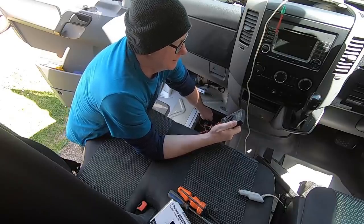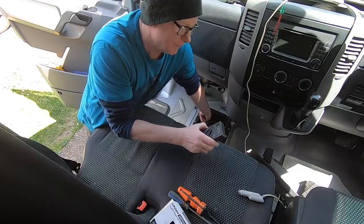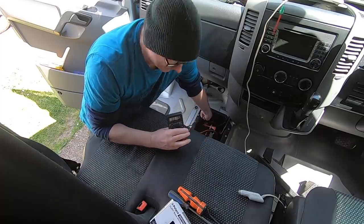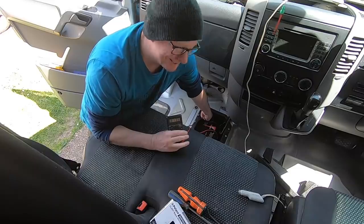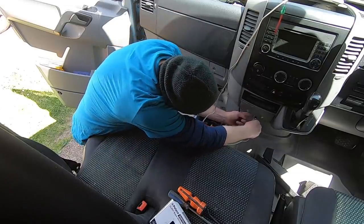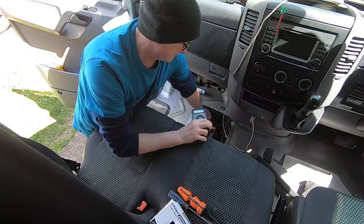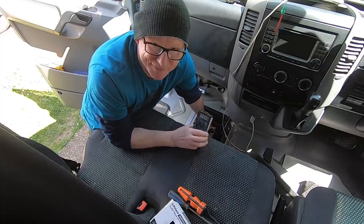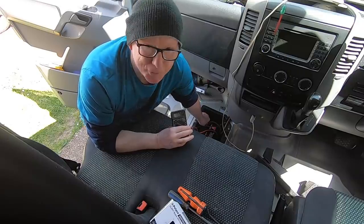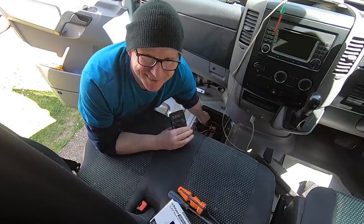My battery's reading - I've got all my interior lights off, though the door is open. There we go, my battery's reading 11.745, fluctuating. I'll push that in a bit better - 11.75 volts. That's just standing still without the solar panel plugged in. Now I'll plug the solar panel in and we can see what difference it makes. The difference is 11.76 volts. So there you go - the solar panel has got a built-in controller because it's not putting the full 20-odd volts into the battery, it's dropped down to 11.76. It's quite safe.